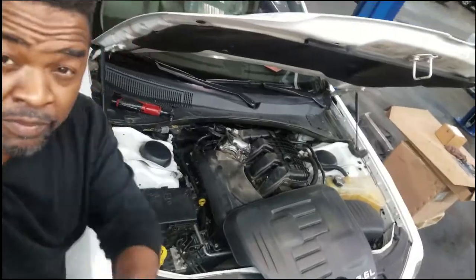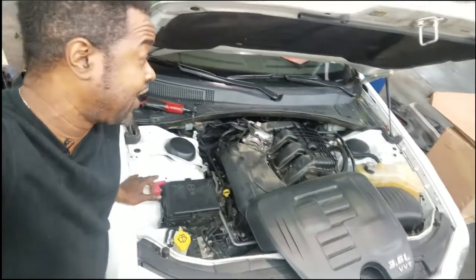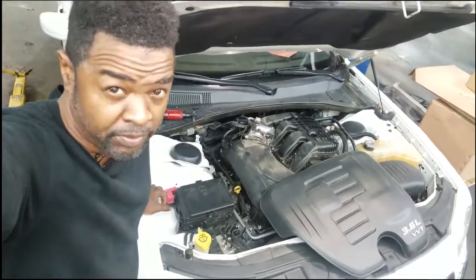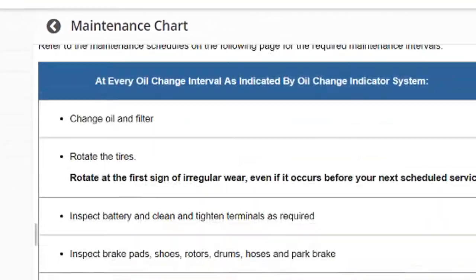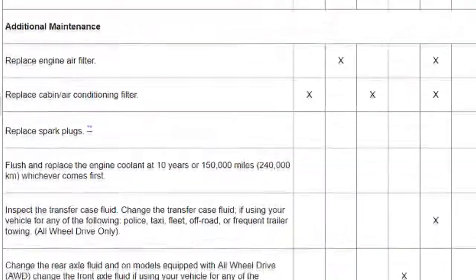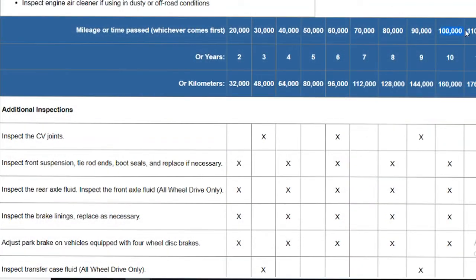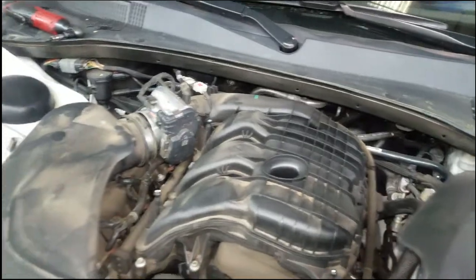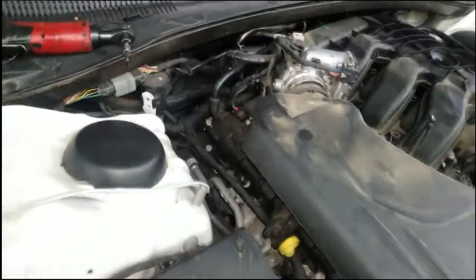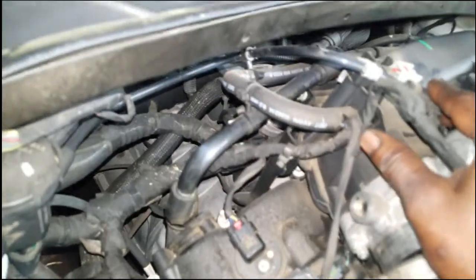There's a time interval on replacing these things. If you go by Chrysler, if you look in the manual, you will see Chrysler recommends you do it every hundred thousand miles — and in fact it says inspect and if necessary replace. I suggest you do it a whole lot sooner than that. If you're doing your tune-up, same thing applies with the PCV valve — no need to wait 100,000 miles to get your PCV valve changed.